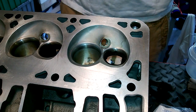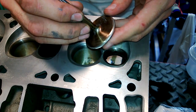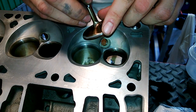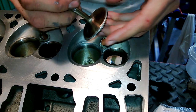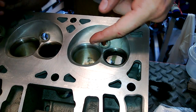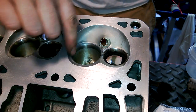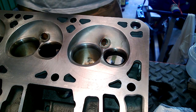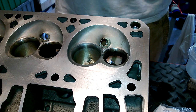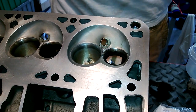What you're looking for when you're done is a nice, even seat area. You'll be able to tell which is the seat area when you look at it because it'll be the only thing that really got affected by the grinding compound. And then you also want to check the seat in the head to make sure you don't have a spot where there's still carbon in the seat track, because that means there was a spot that didn't quite touch. This looks really good — it's nice and uniform, there's no pitting, it feels like it's prepped nicely. So I'm going to be done with that one and move on to the exhaust.